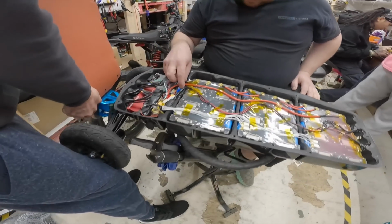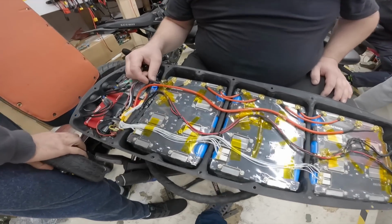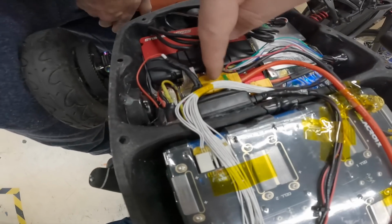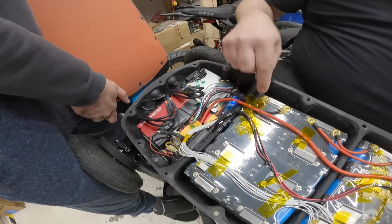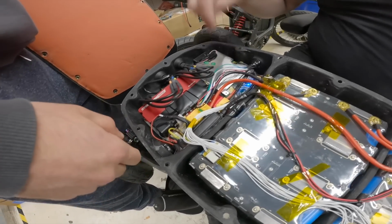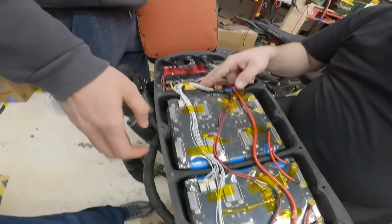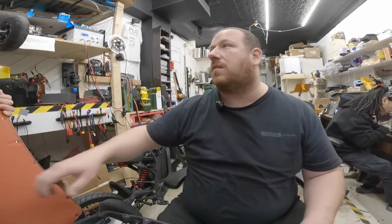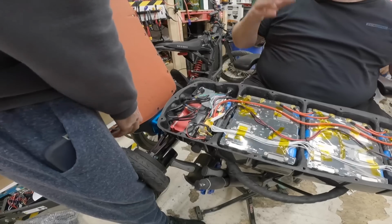And this is a fully bypassed battery. It's bypassed? Yeah. So this is your discharge, going here directly on the cell, and then my B minus getting here directly from the cells. Basically, you're charging only through the BMS. This isn't even a DIY, this is from them, quote unquote. Most of those boards, they bypass. That's the reason why we don't work much on the boards, because it's bypassed.